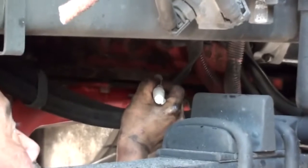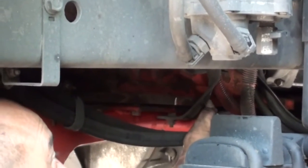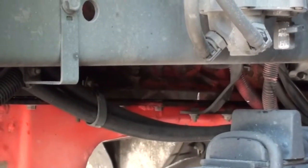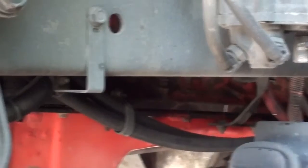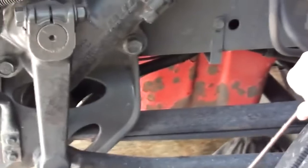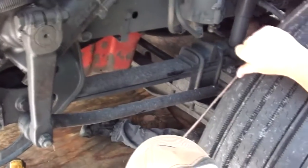I got what you mean. Instead of bolts. Stud. Yeah, and there's a stud in the next one. In the front I got a lot of studs too. Okay, well mark the block. You can mark the engine block right here on the outside. You've got to mark it above the pan because you're going to repaint your pan. Your pan's in bad shape, so you need to repaint it. So go ahead and do all that.